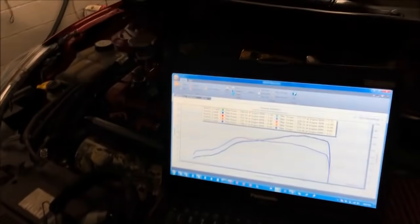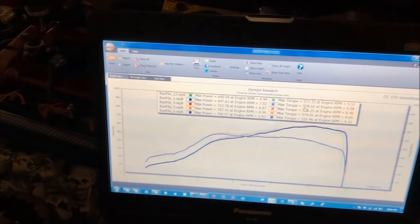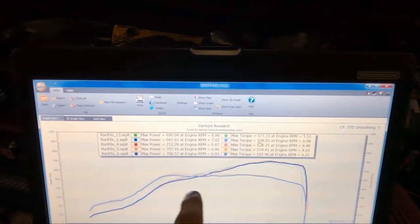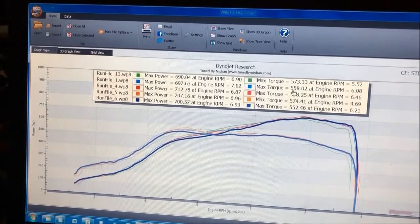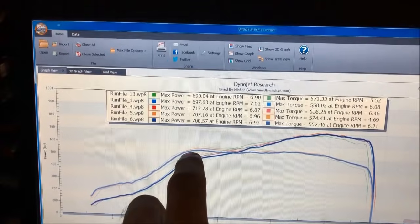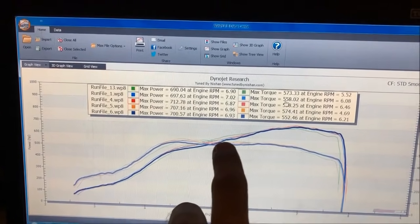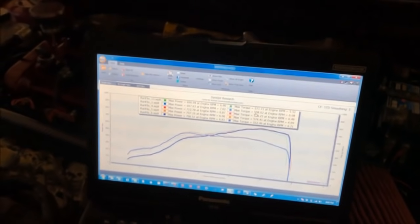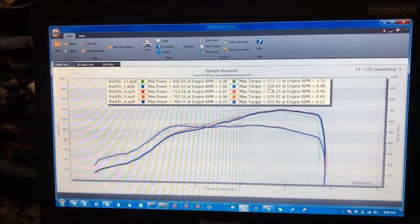So yeah, if I wanted to, I could, but that is not the purpose here. Because it is a 2.5 and we were able to bring the boost in a lot faster, the reason the torque curve rounds off right here and holds flat is my boost control. I've controlled boost to not come in and hit that 38, 39 pounds of boost super early on. So it's tapered. Right around 4,500 RPM, we're only at about 33 pounds of boost, then about 35, then about 36, 37, and then 38, 39 all the way up top by 7,800 RPM. We call that a reverse taper, and they do that to control torque. It's a means of torque control.